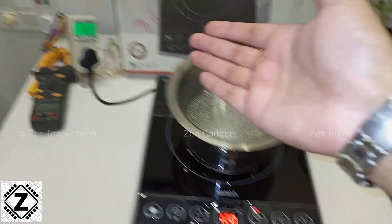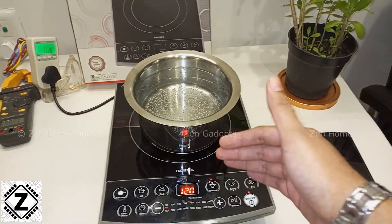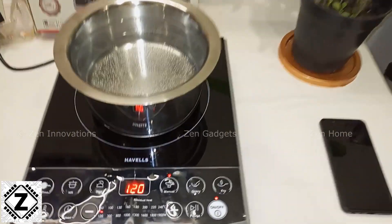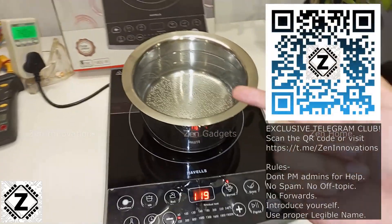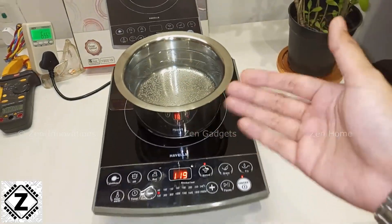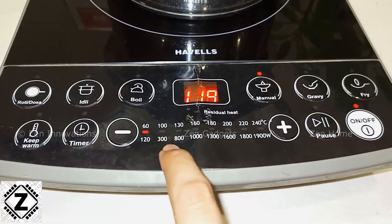So something seems wrong — either the meter is faulty or the induction cooktop is useless. Well, no. This is happening because of the work methodology employed: this thing is working on pulsed energy. If you listen carefully, you can almost find out when the coil is being energized — currently it's off, and then it fires up. The minimum energy consumption of the coil when it turns on is somewhere around 1000 or 1100 watts. What it is doing is using a kind of duty cycle — the coil starts up for one or two seconds, then shuts down, then starts up again — just trying to average the figure.